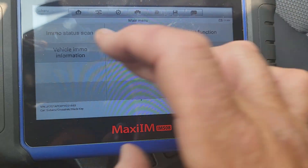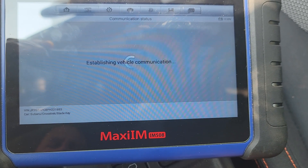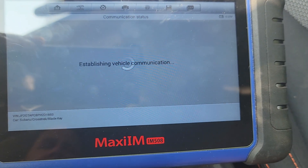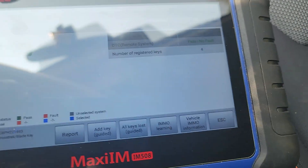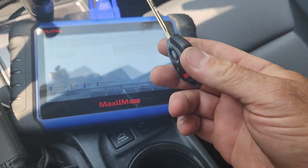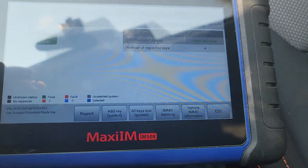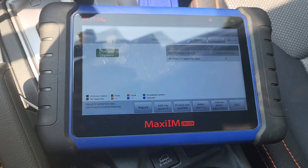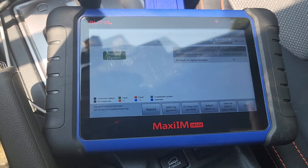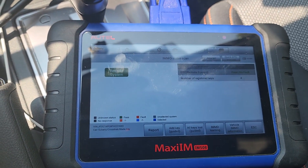If you don't back out and go back in, it still says three - that's what it said before. But if we back out and go back in... imagine that - four keys learned! Our new key and keyless functions work, starts the car just fine. When it says failed, don't freak out. We're at the maximum now, so if we wanted to do another key we'd have to do something differently. That's it - 2023 Crosstrek. Very happy this thing hasn't changed except for the remote programming. Thanks for watching guys.